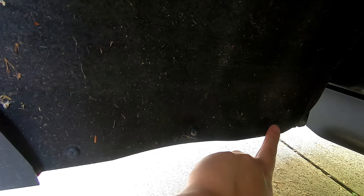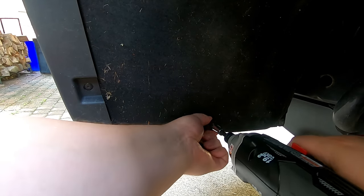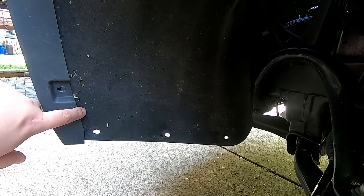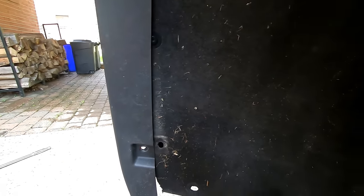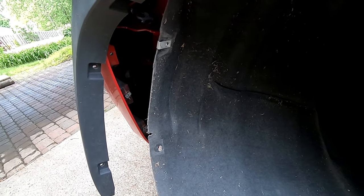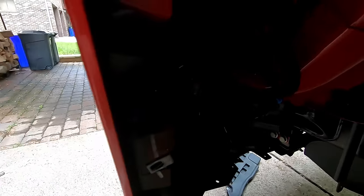At the bottom of the fender well, we have three T15 Torx screws that we're going to have to remove. And if you have fender flares like I do, you'll have to remove them to allow this to be pulled back enough to get to the bumper screws. You'll want to actually move the fender flares out of the way a little bit to expose one more hidden T15 Torx head right there. Once you take that out, you can move the fender shield completely out of the way. This won't likely be an issue unless you have the fender flares, but I was able to get it pulled back enough to see the screw heads right there.